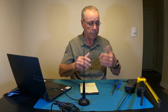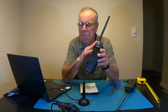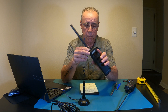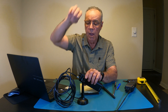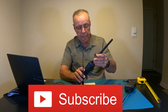We're gonna test if it works and how it works. Basically you just take a CB walkie-talkie — I have the first one I bought about eight years ago right here, a very basic but awesome walkie-talkie. You take out the rubber ducky antenna that comes with the radio, hook on the mobile antenna, and you're set. Then you put this on the roof — I'm gonna show you how I channel the cables on my truck.